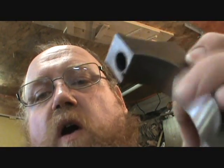The only thing I forgot to check was the time that I started. It's 3:10 now, and I'm just getting ready to set the crank in. And after that, I would be ready for the rods. Well, and also I took the Scotch-Brite to these too and shined them up. And remember, no oil in here. No oil, no nothing goes in there. That's dry. You set the main bearings in dry. They're on any motor, unless it specifies different, and that'd be the first motor I've ever seen. All the bearings get set in dry.